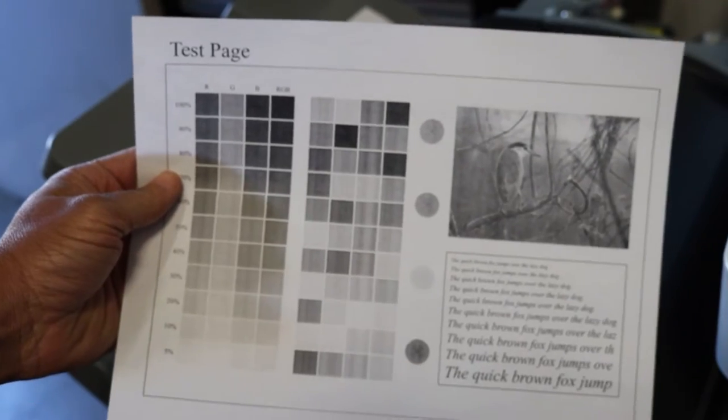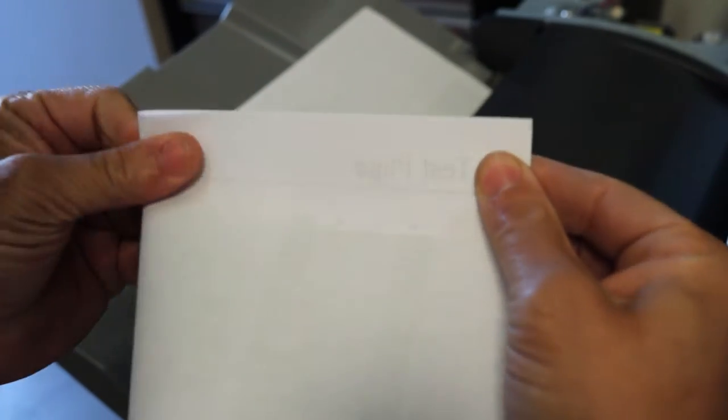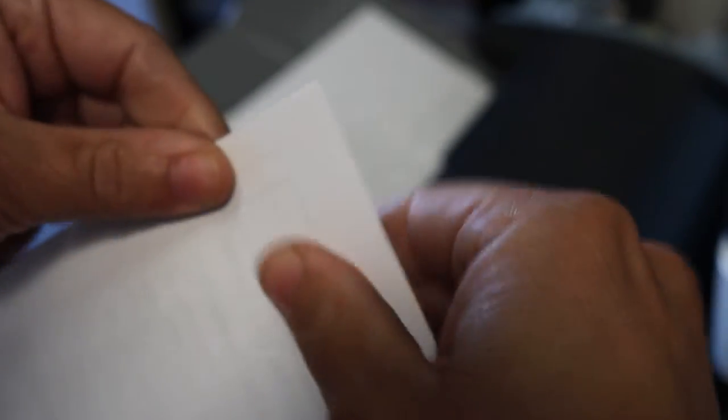So you'll see it has a nice straight line there. I'm just going to fold it in on itself. Get it as straight as you can and then crease down the middle. And with the paper perfectly lined up, you're going to look at that line. If the line folds right in on itself and matches perfectly, I know the camera's a little blurry, but if it lines up like this one does, you more than likely don't have a skew. And you can do the bottom side as well. Just look how the line is nice and straight. So we have no skew there.